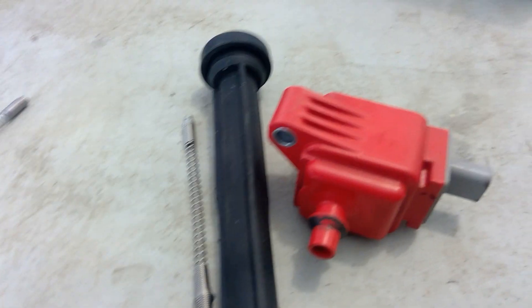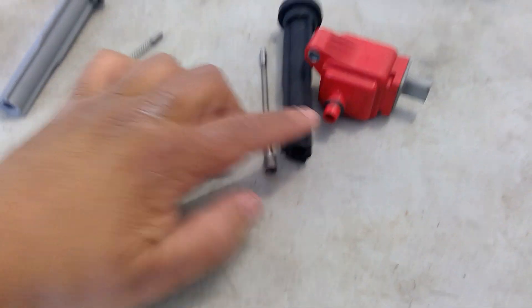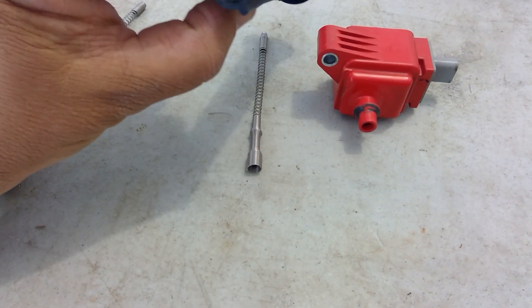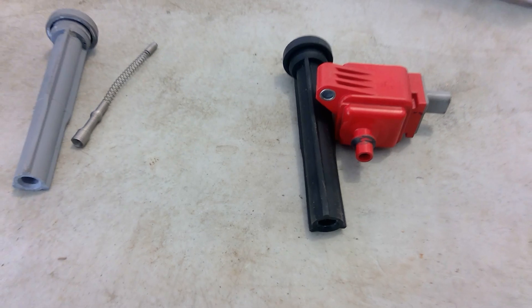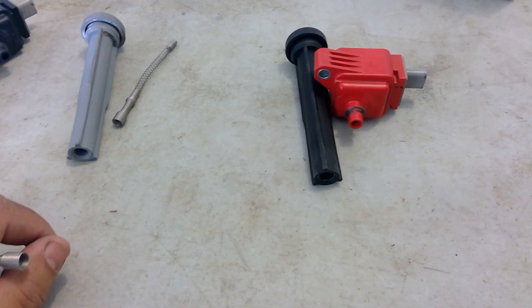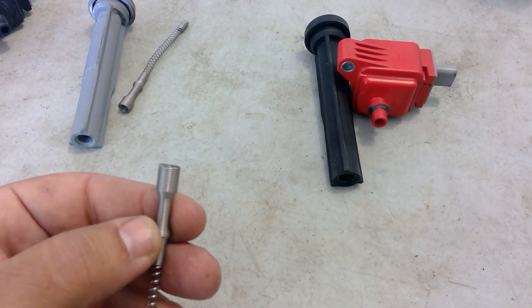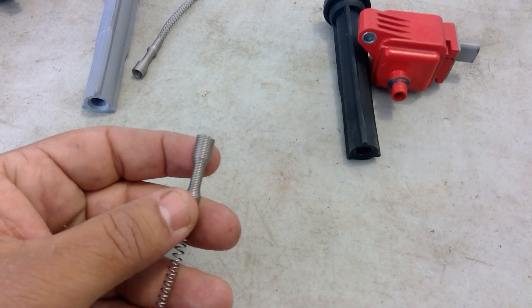I look at my MSDs, and you've got to look for what's called Ignition Carbon Tracking Misfire. On the black boot it will be harder to see, but on a color like this one, look for any marks on the inside on the side. I could see a little bit here. You'll see like a burnt mark on the boot itself or on the spark plug also - you'll have maybe a little line, like an arc that was very hot. If you had a severe misfire it will be on your porcelain of the plug. Also in these tips, it's hard to see, but it's burnt. I actually wiped a little bit off with my finger by touching it.